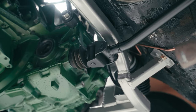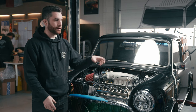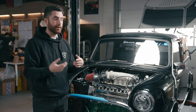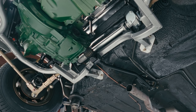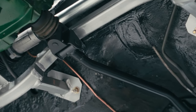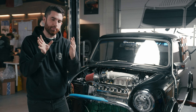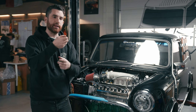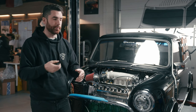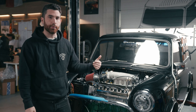The other detail we've got is the shifter. The way this engine is mounted with 65A poly mounts — stiff enough to take out vibration but the engine still doesn't have room to rock back and forth — means we don't need the stabilizer rod. Normally on a Honda engine, a stabilizer rod connects to the shifter housing so that when the engine rocks, it pulls the shifter with it, keeping shifting precise. But because the engine isn't moving much, we can do away with that rod, which really helps with clearance for the exhaust system.